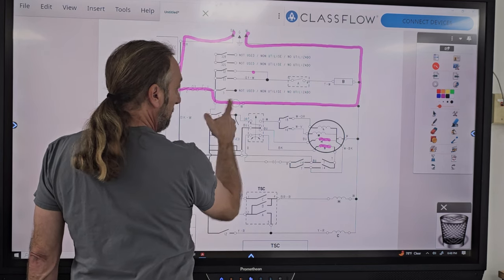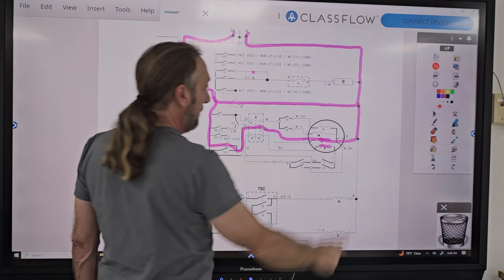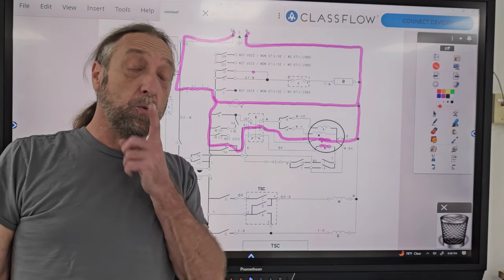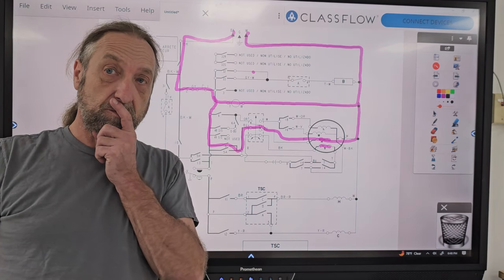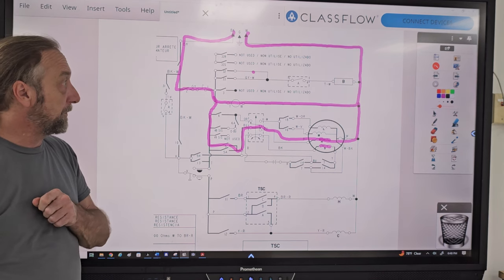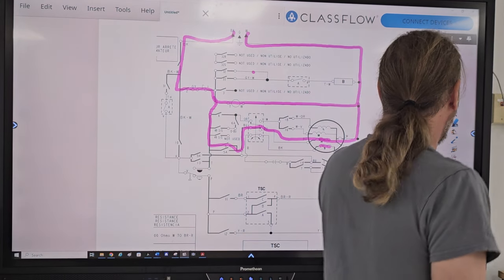Okay. So we have to probably feed, let's go through five and let's feed the motor. So that's that. But that's for spin, but it's not washing. So I would look for the agitate and see if the cams that feed those switches.